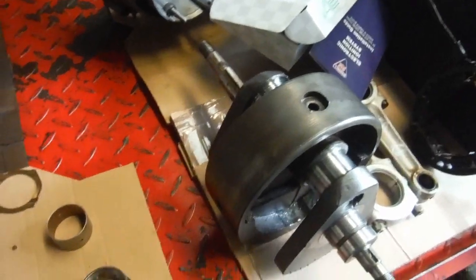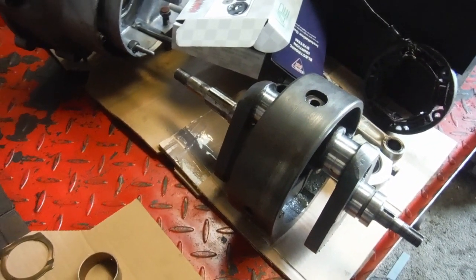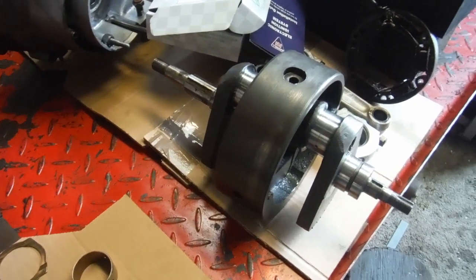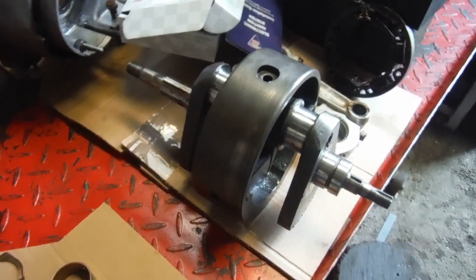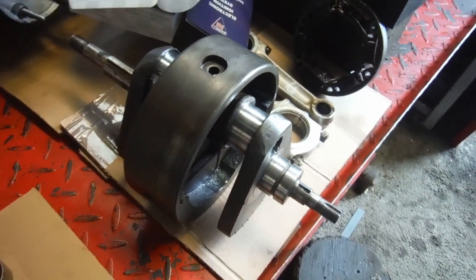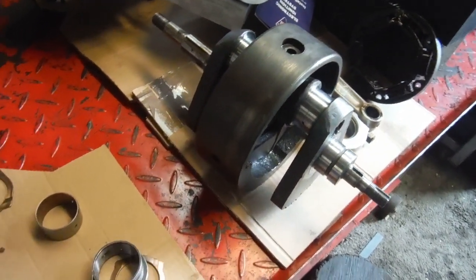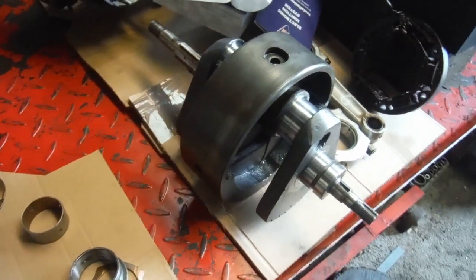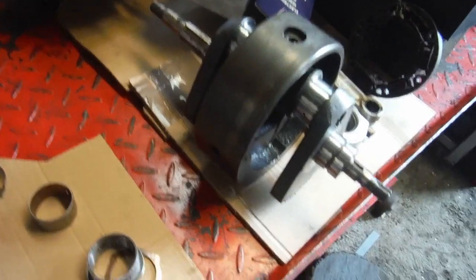And the last engine that I did in this manner, when I trial fitted the crank and tried to spin it there with no more than 1/1000th of an inch clearance on the timing side, I could spin the crank between finger and thumb, so that told me that there was nothing to worry about regarding alignment.